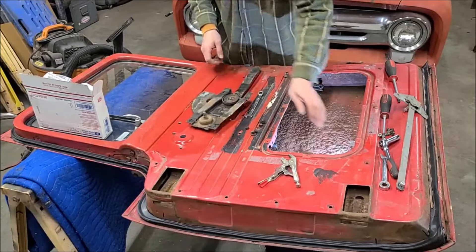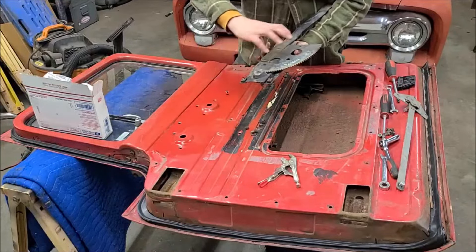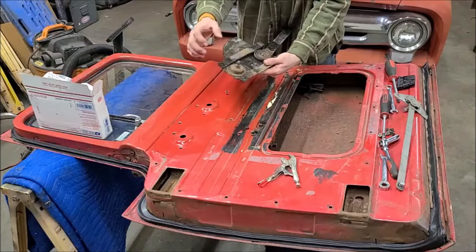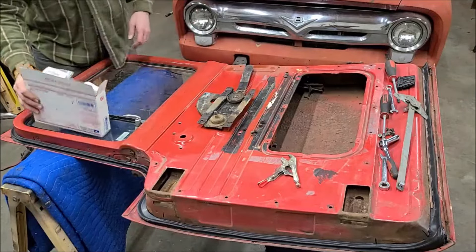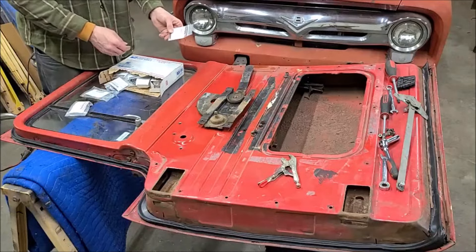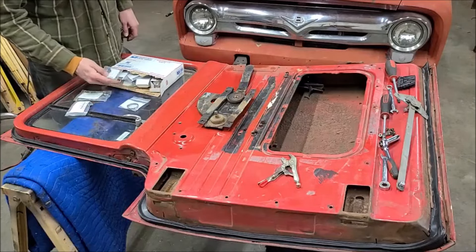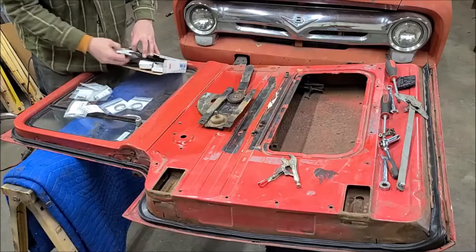According to the instructions that Mid-50s provides, you need to move the regulator to the position of the window being all the way down, drill out that rivet, mark the gear on the other side, and then drill the gear holes big enough to get a screw head through — because you're drilling rivets out but replacing them with bolts. I got a rivet gun so I might just rivet it back together if that's possible. I also went ahead and bought a new spring because they supposedly break really easily — it's part number 1103-SP56, specific for '56 versus '53 to '55.